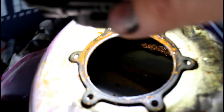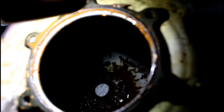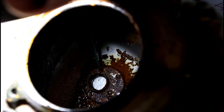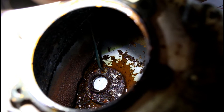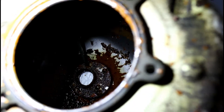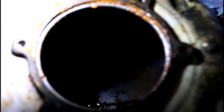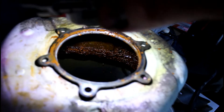So that's my mission. I think it's probably going to be better to try and do it this way — plug up the normal fuel filler down at the bottom there, and then I can fill this whole tank all the way to the very top with the sodium carbonate, and then we can use electrolysis to pull all the surface rust off, hopefully. So we'll have a look at how that pans out, but yeah, horrendous.